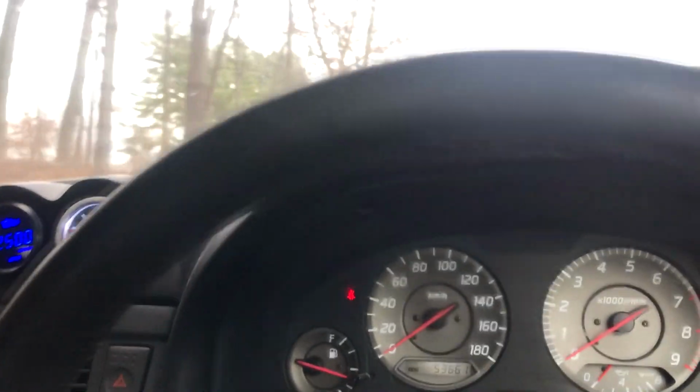Like I said, I don't think I said in the last video, I think I replied to a couple comments, but it ended up being that the tire didn't have enough pressure on the left front side, and that was the issue why it was shaking. And so I had to take apart the barrel and the lip because it's leaking a little bit of air, three-piece problems. So just driving it around here just to see how it is.